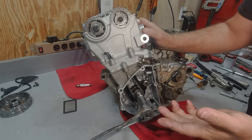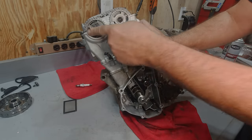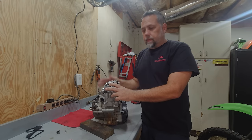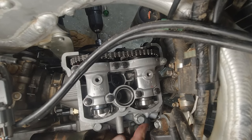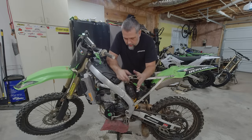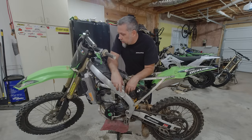At this point we'll get our cam cap back on - don't forget your retainers or locator rings. Now the O-rings come into play to keep oil from the cylinder head going down into the spark plug hole. If your bike has the little weep hole in the side of the cylinder and you see oil dripping out, that's because oil is getting past these O-rings or they're not in there. The smaller one goes on the bottom, the bigger one on top. Following your tightening sequence, torque your cam cap back down. Once they're tightened down, make sure both spin freely - then remove your zip tie. Get the tensioner back in. On these Kawasakis, take the back cap off, remove the spring, push on the little ratcheting mechanism and push it back in. Re-verify you're still on top dead center and your timing marks are lined up, then do a couple full rotations to make sure nothing's binding. Bring it back to top dead center - remember there are two top dead centers on a four-stroke, so if your timing marks don't line up go one more full revolution. Top dead center lined up, you can put the rest of this engine back together. While the valve cover dries, I'll put the built engine back in the frame. I'm also running the motor forward a little bit after filling it with oil to make sure I'm getting oil up to my journals so I don't have a dry start.